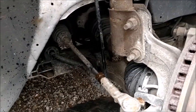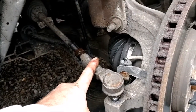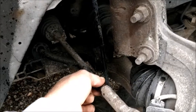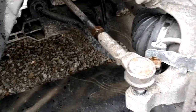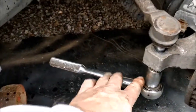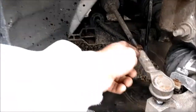What we're gonna do today is put new tie rods on this car. All you're gonna need is just a couple wrenches. I'm gonna use a crescent to break this loose here, and then I already got my ratchet on here. We'll spin this off, knock it loose, and then slip the threads into this.